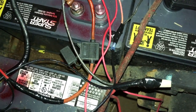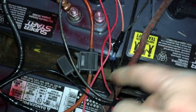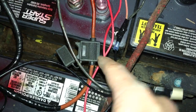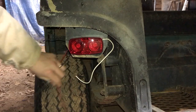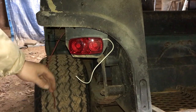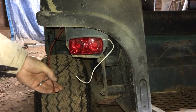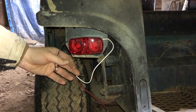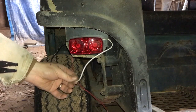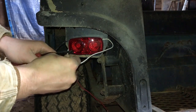You don't want power going to your wiring system when you're hooking in. You can disconnect the main cables to the cart, or I'll just pull the inline fuse out — it has an inline fuse housing right here for my lights. I'll pull that fuse out to cut the power. Now I have my wires tied into the rest of the lighting circuit. Keep in mind: in the rest of the circuit I've got red and black — red's the hot, black's the ground. With my new light having black and white, black is my power and white is my ground. Strip the wires and connect them up.